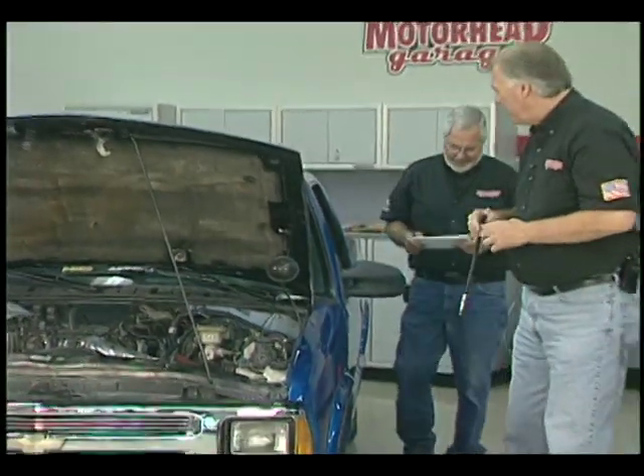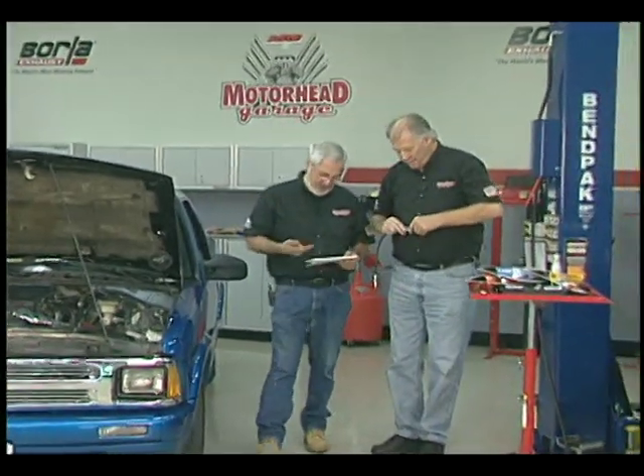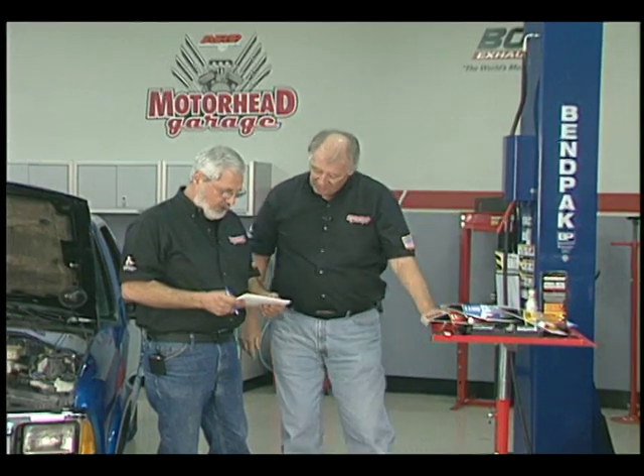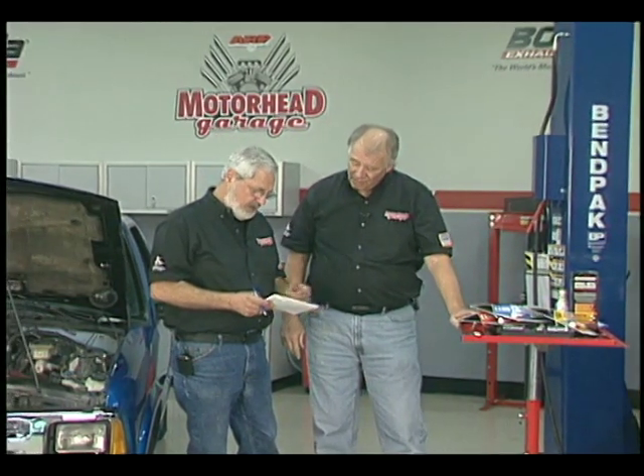All right, Davey, that's not bad. We've got two cylinders that improved a little bit, and we haven't driven this very far, so we'll put some more miles on it. We'll do an oil consumption check. So we've got 160 on one, 150 on another? We've got a couple of increases in a couple of cylinders, so that ought to work out pretty well. Hopefully we'll clean up the oil consumption on number one cylinder, maybe take that plug clean. We'll put some fresh plugs in it so we can read those — make it run a little quieter and smoother, too.